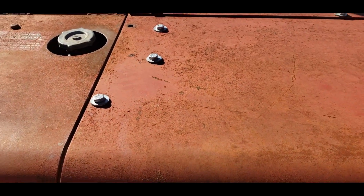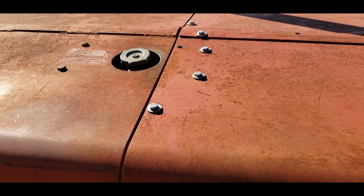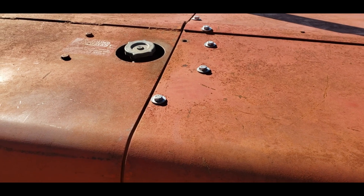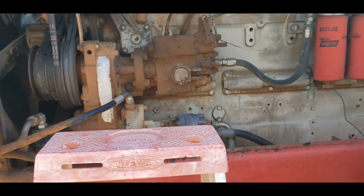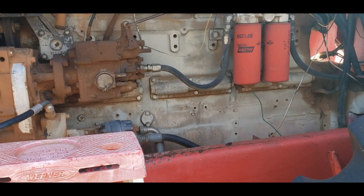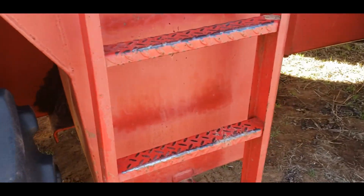The reason I'm doing that is: if this tractor is going to leak everywhere besides that little O-ring, I need to know. If I let it come up to operating temperature, cool down, and pull the dipstick and the crankcase is full of water, that means the cooler is not sealing internally — that's also bad, and we need to know that now. It's not as extensive as getting it hot under load, but if we can get it warm and it's not leaking anywhere, that's a good start. Maybe that little O-ring leak will stop when hot — or maybe it'll get worse. I need to know.